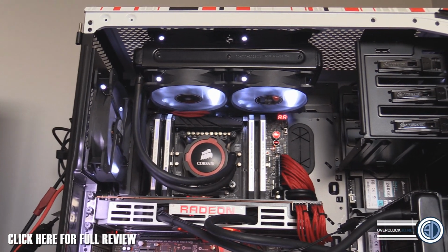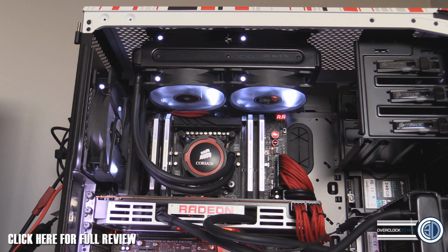With the side panel on, there's an increase in CPU temps, and that's just because that top radiator sucks all that hot air in. We generally don't have problems with graphics cards in the rigs causing the CPU to get that much hotter, but obviously we've effectively got 4 290s running in this, and there's an immense amount of heat that gets dumped inside the case, and it all ends up out the roof.